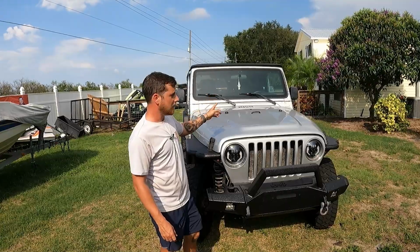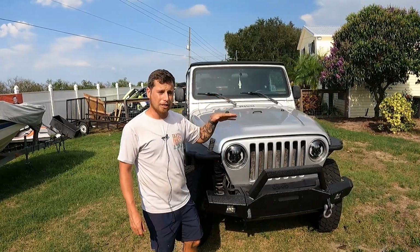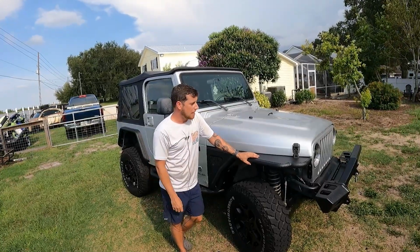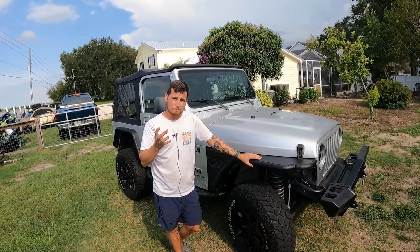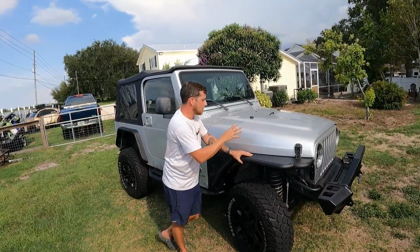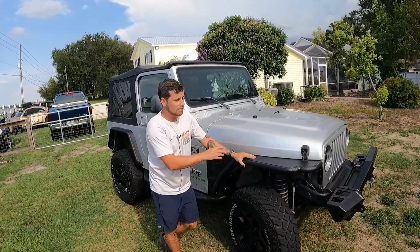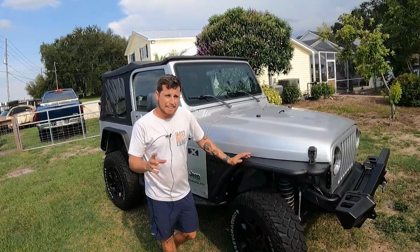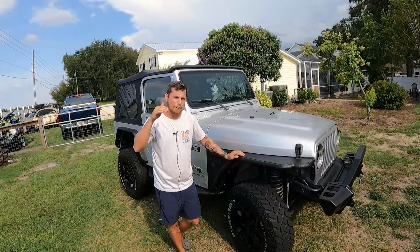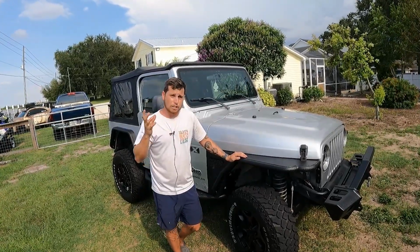I need to go over that, look down there, check all the wires, make sure there's nothing messed up in that. One other thing I think it could be is the oil pump drive assembly. I'm pretty sure that's what it's called, the OPDA. I've read that as an issue with these on these 05 and 06 TJs. They go bad and they start getting loose. That causes skips and issues when you get to a higher RPM, and that's what our issue is.